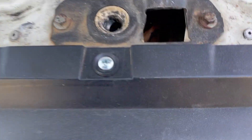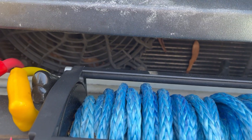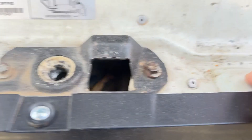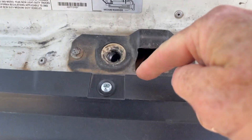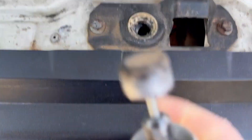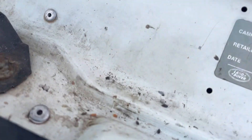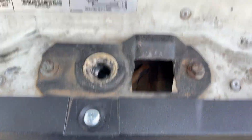Luckily my grill has an area where I can get my hand in. The mechanism right here is held in a kind of cover with four rivets. I used a dremel to grind down one that was right here, and then used a hammer and a screwdriver to shear them off through the grill. I got a little too aggressive right here but was able to peel it back.